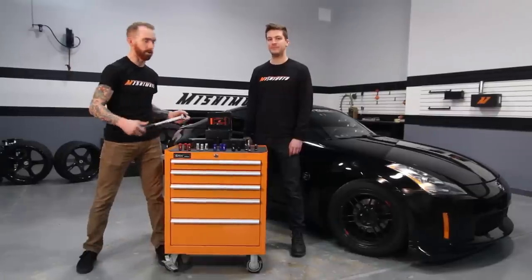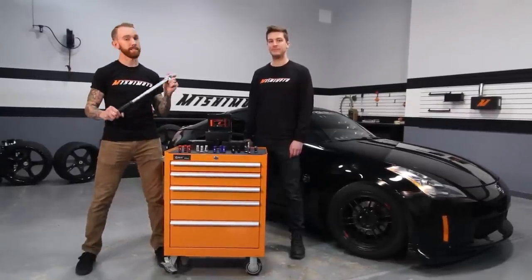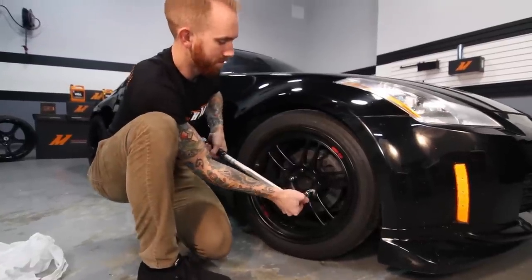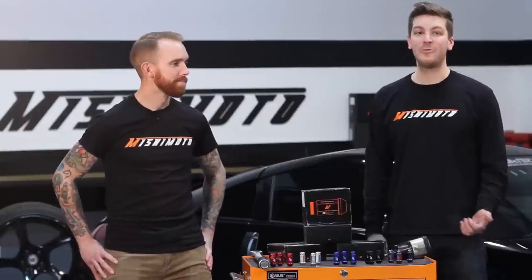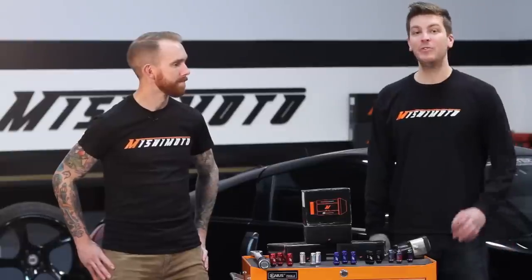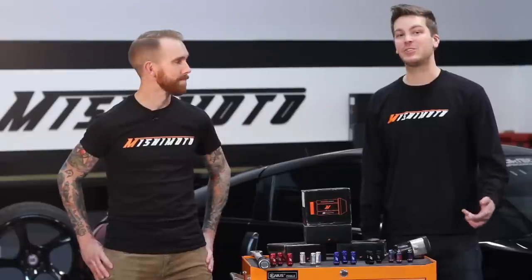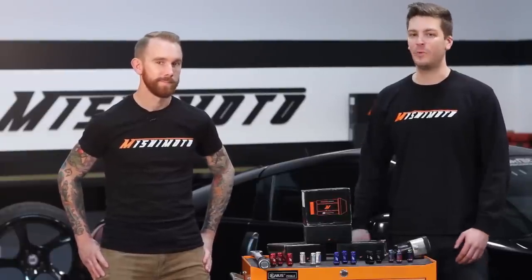You're always gonna want to use a torque wrench. Make sure to set it to at least 70 pounds, under 85 pounds to keep these things nice and tight. We know there are a few special tools with either rubber or plastic inserts to help you install your lug nuts without scratching them, but for you DIYers at home, we really wanted to give you guys some more insight as to things you might already have in your house. That way, installing these will be a breeze.